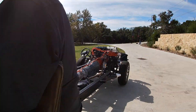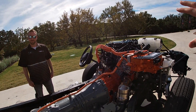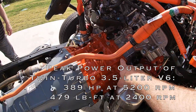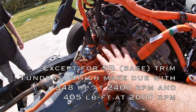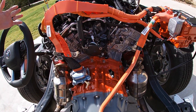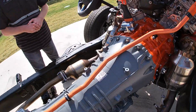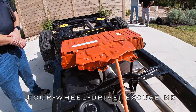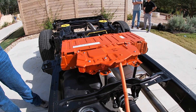Craig, your expertise is more in the powertrain. What we're looking at here is the hybrid powertrain — it starts as the same twin-turbocharged 3.5-liter V6, but then in between where the crankshaft is mounted and the beginning of the transmission, this is the motor, this is the hybrid unit right here. It's a parallel hybrid system — this orange part between the rear of the engine and the front of the traditional transmission holds the electric motor and generator. Moving further back we have the transfer case — this particular chassis is all-wheel drive — and following this orange down, this is the battery pack, which is 1.87 kilowatt-hours.